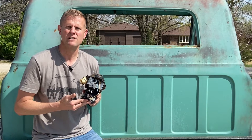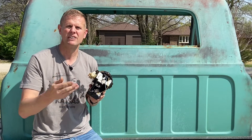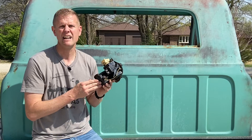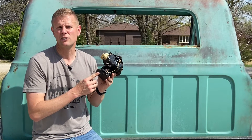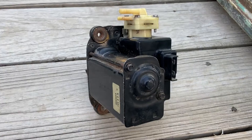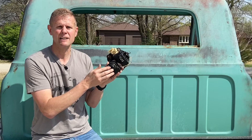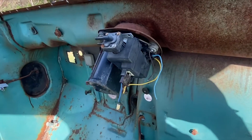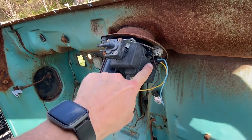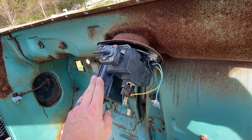It is imperative that we get all the wires in the correct position or the pump or the motor is not going to operate properly. It's also imperative that you mount the windshield wiper switch so that it connects ground between the motor and the switch itself. We also need to ground the motor because it's mounted to the firewall with rubber pads. There is a spot with a brass ring and a little strap that mounts to the motor — once we run the bolt in, that's going to make our ground. This is where a lot of guys get screwed up: having their wires in the wrong positions on the pump and the motor.